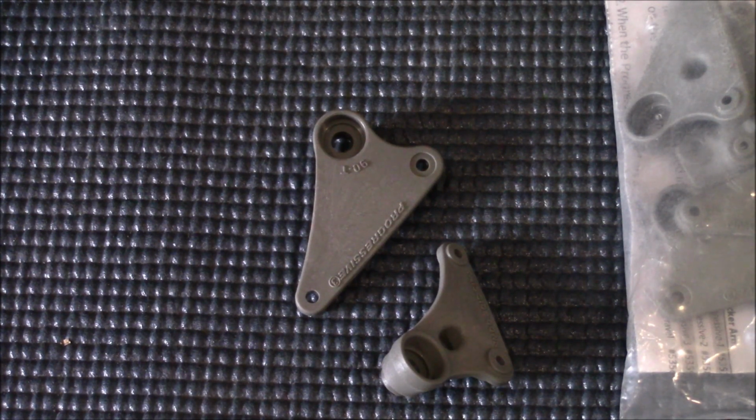Now, you might want to go to the number 1 rocker. That's going to provide a lower progressive rate that maintains constant dampening force throughout the whole range of the suspension travel. Okay, now this is best for when you have extremely rough terrain and it requires maximum suspension articulation. Maybe you want to go to progressive rate number 3, and you would do this to improve high-speed cornering on smooth surfaces. It's also going to provide a better, firmer feel for the body roll, and it's going to have less brake dive, and the rear end will also squat less.